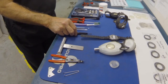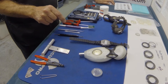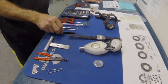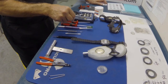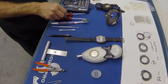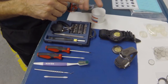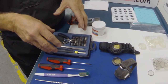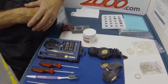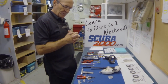You also need a proper tool for taking off the watch strap. Some computers require that the watch strap comes off in order to change the battery. You can use a screwdriver, but you'll weaken the pin, scratch the pin, weaken the spring — the strap will come off and the computer's gone. There's a proper tool for that. You need cleaning tools: Q-tips, very clean linen, and a brush of some sort. You need a proper pick, used properly. You might need various screwdrivers — some computers require Torx, some use safety locks, some use Phillips, some use Allen keys. You have to have a proper precision set of drivers for all the different computers. You need some grease and a tester to test the batteries. We always test the batteries coming out and the new battery going in.